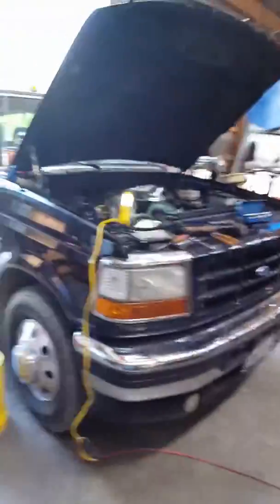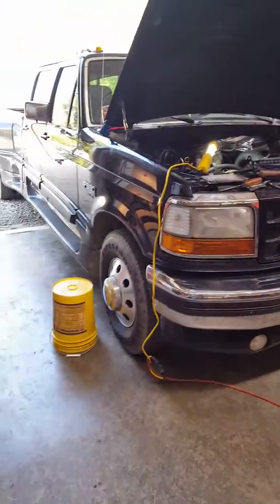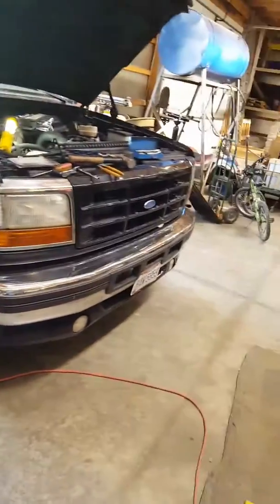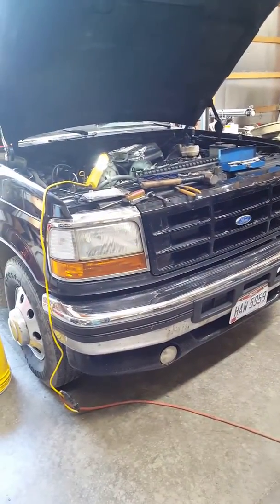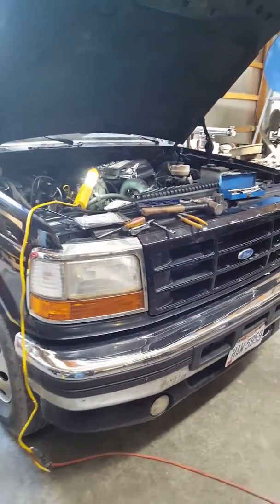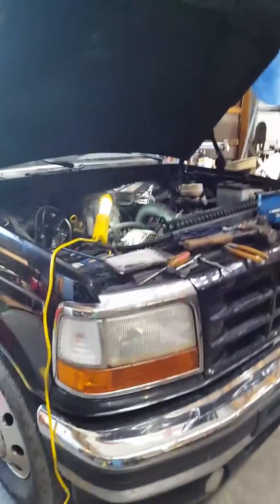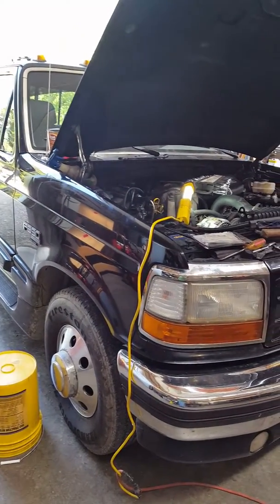I really do. I don't know if you can see it or not. And having all kinds of brake problems with it. I got on the internet and on these Ford forums, on the Q&A site, and they're saying, oh yeah, it's your master cylinder. Well, we put a new master cylinder on it, and the brake pedal was real spongy. Tried to bleed it, bench bled the master cylinder. Every time you come up to a stop, the pedal just slowly sinks to the floor.